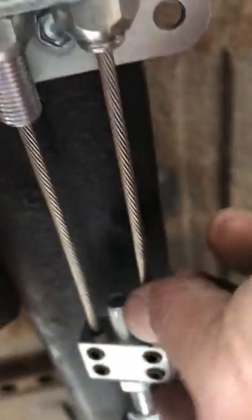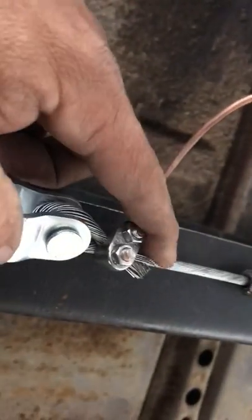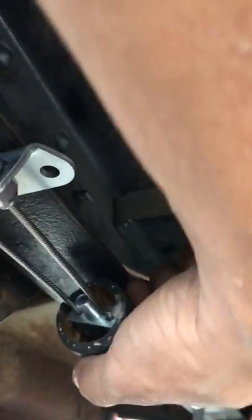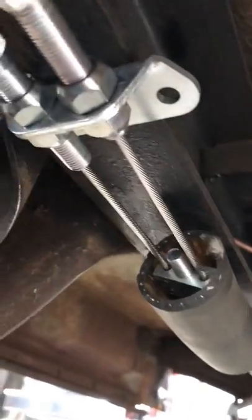What I think is cool is this whole cable equalizer setup they give you. Your cables run through here — this is all CPP hardware all the way to this point, and from there forward is your stock parking brake setup. Right here I didn't have any stoppers on this cable since it was already cut, so I got one of these little U-bolt clamps for cables, made a loop, put it on the side, tightened everything up, and that's it. I put a piece of radiator hose right here and I'm going to zip tie it so when it moves around you don't hear it clinking.